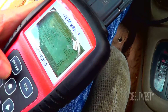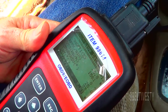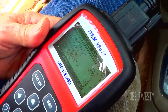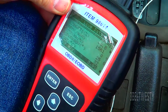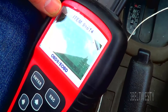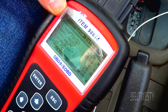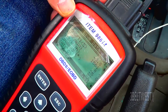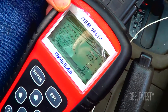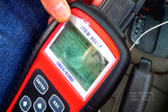There's what on this car seemed to be an issue — when it pukes. This is a 1995 car and it's not fully OBD compliant. What happens is that generally when it starts to screw up, it drops the data link. I'm using this Harbor Freight Centec meter, or I use one that hooks up to a laptop — it does the same thing. I've tried it on three different units. The downside on a 1995 car: some of them are not fully compliant because full compliancy started in 1996. A 1995 car will tend to — these are not OBD-II at all, or they're sort of compliant in the sense that they didn't meet all the specs. Some do, some don't. This particular one — you drive around, you'll have an intermittent problem, it'll go nuts, and it drops the data link. It's very frustrating.